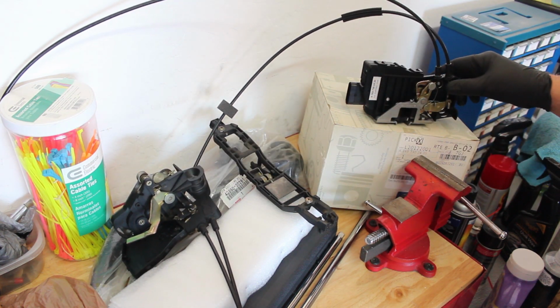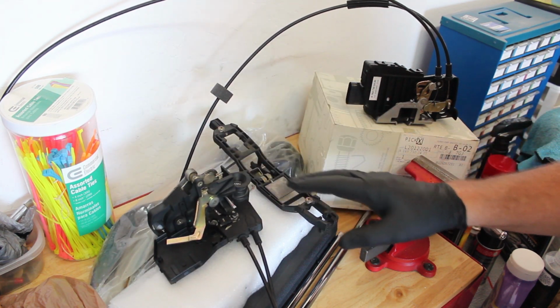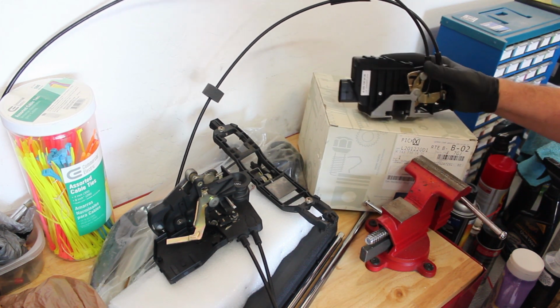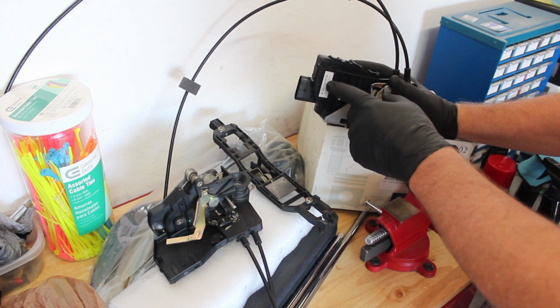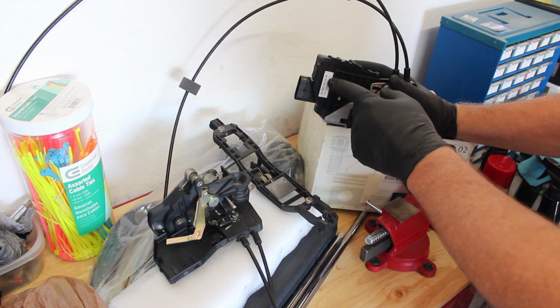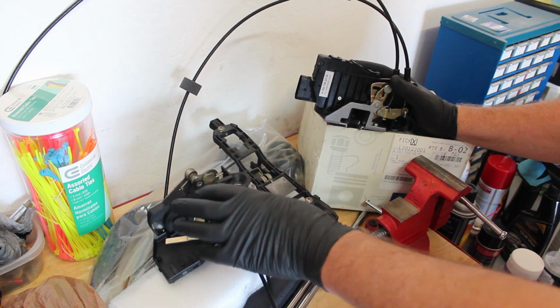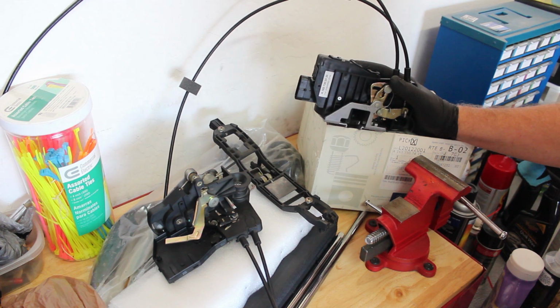Now I got a new replacement part, and the reason I did that is because I took this old one apart. I was going to try to repair it, and I found too many broken pieces in it, I think from age and the plasticizers drying out. So I ordered a whole new assembly, and the new assembly actually has a different part number. It's 163 730 24 35, and the old one was a 1235, which means this has been improved somehow. So hopefully they made the gears a little better, or maybe out of a little stouter plastic, because we found a cracked nylon gear inside here, and also a locating pin that was damaged, and a couple of things that probably made it so it wasn't operational.